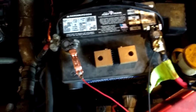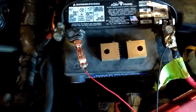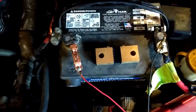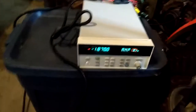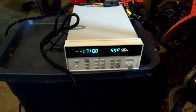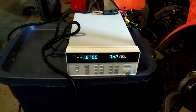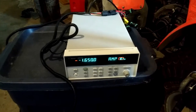Along with this, in order to calculate the joules of power, I've also attached two leads which are going to be measuring the voltage as the engine attempts to start. These two connections are run to a data acquisition system, which is going to log and monitor them. I should be able to get at least five samples per second, hopefully a lot higher, so I should be able to get good data in order to calculate everything.